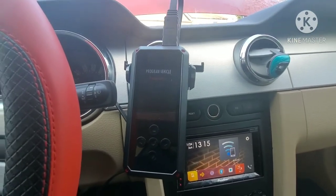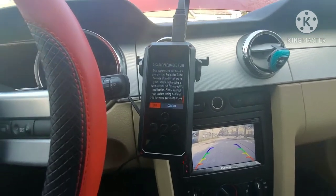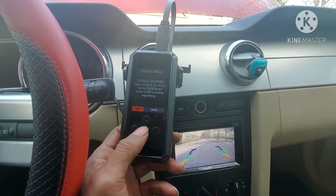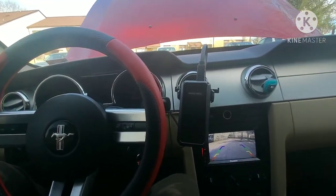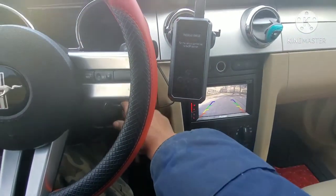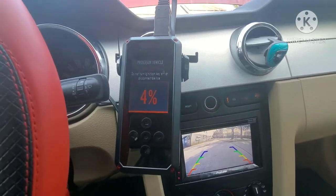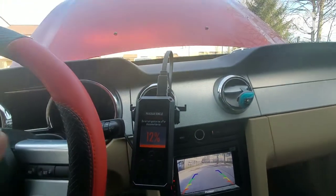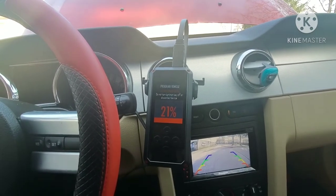It's programming — just give it a quick sec. 93 octane race tune, continue. While it's writing I need to turn my key off and turn it back on. Okay, so we turn it all the way off, turn it back on. There we go — saving my stock data. Once again my check engine light came back on as it's saving my stock data. So if anything was to go wrong with my cold air intake or whatever, I can revert back to my stock tune.